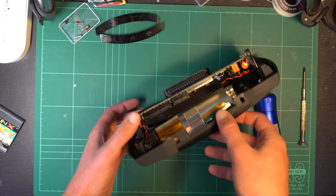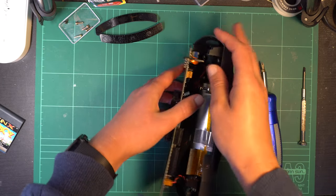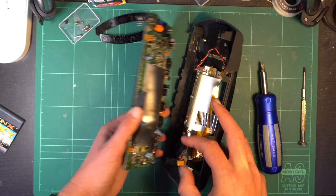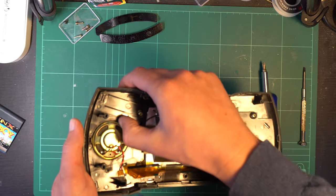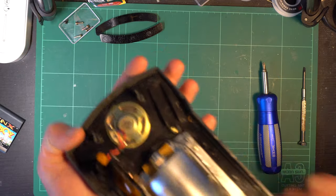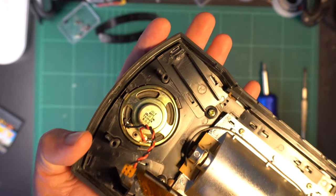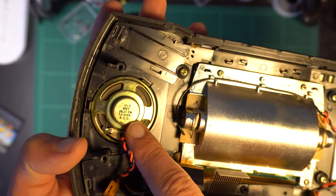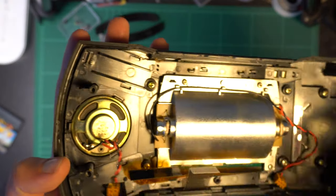After those, there are two more plugs to remove — one for the screen assembly, and one for the speaker itself. These are not held in by any sort of clip system, so these can simply be pulled out. And there's the speaker. I wasn't able to source a speaker that has that clip attached — I don't actually think there is a version out there, although the speaker itself is quite common. So we'll be removing that speaker, de-soldering that clip, and then re-soldering it onto the new one. Very simple stuff.